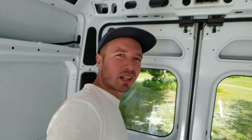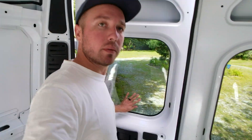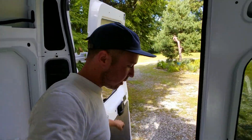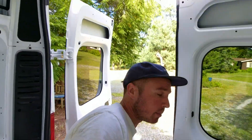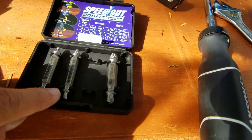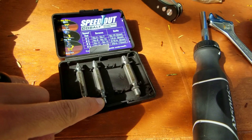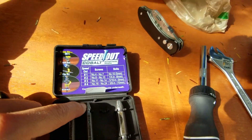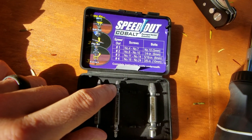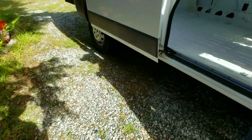We're back from the mechanics — well, it's like a tire place — and they couldn't help us. I think that bolt is welded in there, so we're going to try someone else. We ran to Home Depot for the third time today and we're going to try this little tool. You use one end to drill the top of the bolt out, and this part threads deeper into the bolt as you put the drill in reverse — so that should take out the bolt.